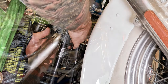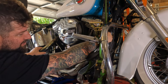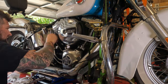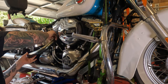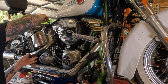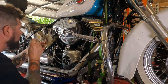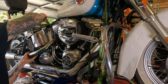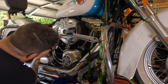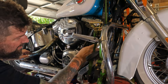Hopefully. Everything is unbolted. We're going to jiggle it a little bit. We're going to make sure the flanges are down off the exhaust studs. Might have to get behind them with a screwdriver and give them a little flick. Careful you don't break any cooling fins off doing that. There we are. Just slide those all the way down.